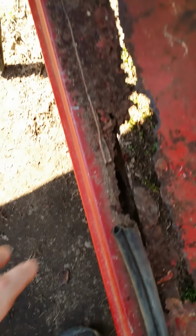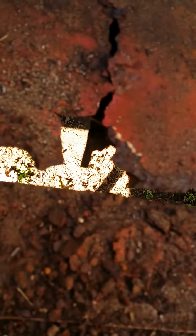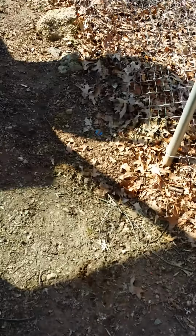My question is, on this side, I understand how to cut out the sheet metal and replace. I don't know about basically the floor joists across, because there is no structural frame left. There's part of one here and a little bit of one there, but everywhere else they're gone. They're eaten up for at least half of the distance from the door into the console area. On this side, on the passenger side, there is nothing here.